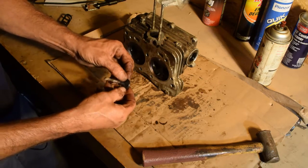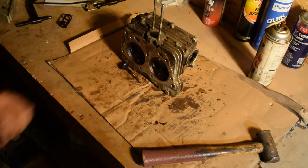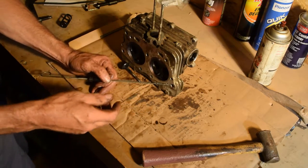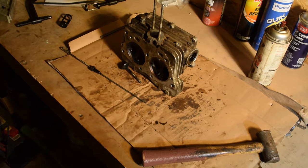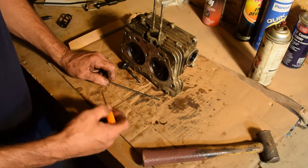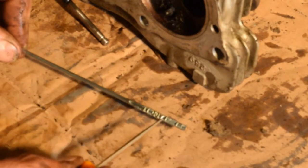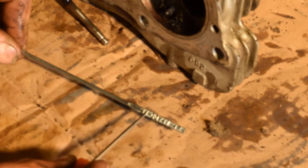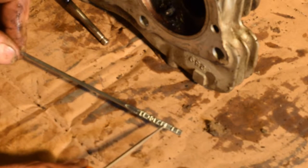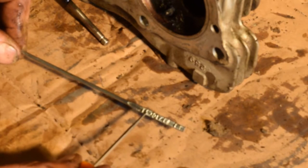The motor itself is a 350cc Robin engine. It takes a quart and a half of oil. With the quart and a half of oil, let me show you this. I had marked it for him. This is kind of critical because there used to be oil dumped in the air intake. So here's your low, here's your add, here's your full. But with the quart and a half of oil, there's full. The difference between here and here is a good half a quart of oil.